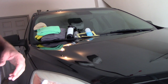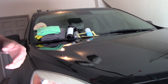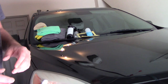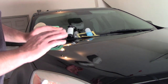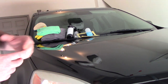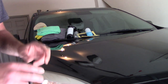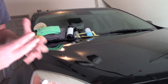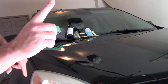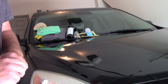I don't want you to cringe every time you use a product because it's too expensive. This coating is a really nice DIY coating, very user-friendly. You can use it in direct sunlight, but I'd recommend in the beginning until you get the hang of it — your learning curve flattens out real quick — then you can use it outside in the elements. Don't use it on a smoking hot panel, but it can be used on a cool or lightly warm panel. I like it on the paint, plastic trim, headlights, and taillights. It can be used on glass — that's personal preference. I'm not a big fan of using DPC Shield on glass the same way as a typical glass coating like Glassparency. When I do apply it to glass, I wipe it on and immediately buff it off — I don't let it sit for three or four minutes — and that gives me absolutely streak-free glass.